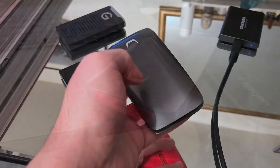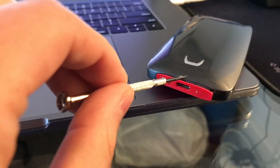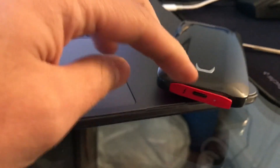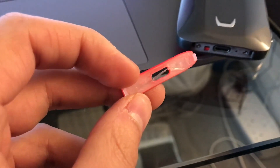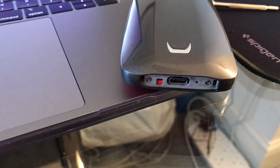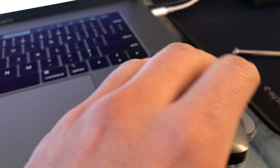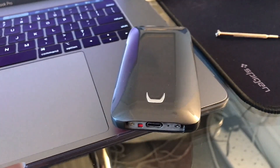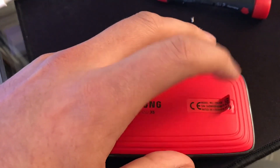So the first thing you want to do is remove that red tab — I just use a screwdriver to pry it up. There are two tabs holding it on the side; you literally just pull on it and it comes away. Just be a little delicate so you don't snap the tabs. Once that comes off, there's just a bit of glue holding it — smooth that back with your finger before reattaching. Then there are two Phillips head screws and one underneath a sticker that you peel off. You don't need any fancy screwdrivers for this.